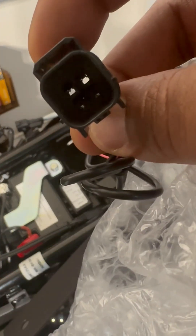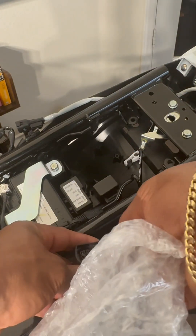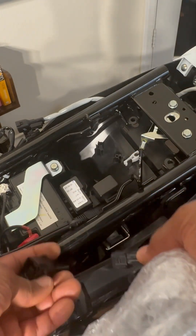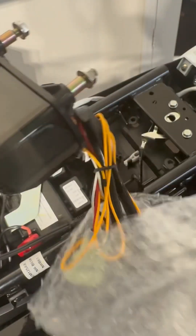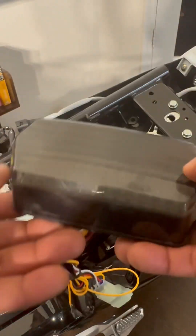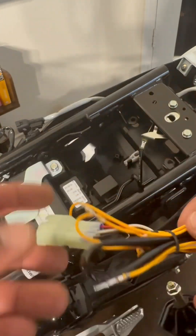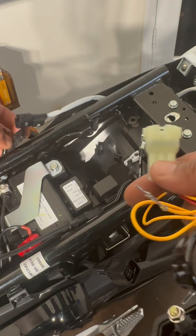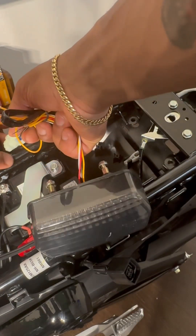All right, so this is the tip — this is the license plate eliminator. It's got a little LED to highlight the license plate. It connects right there. Now, this has two holes in the male adapter, and the reason is because the yellow wires on the tail light are going to go inside those two holes, so just keep that in mind — we'll be coming back to that in a bit.